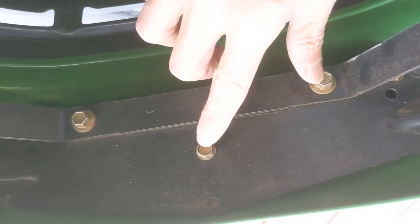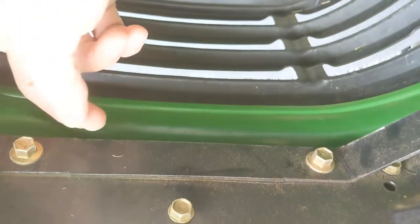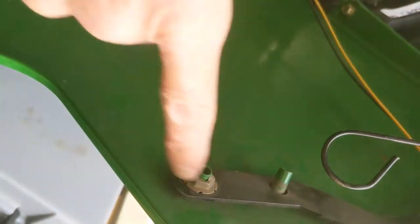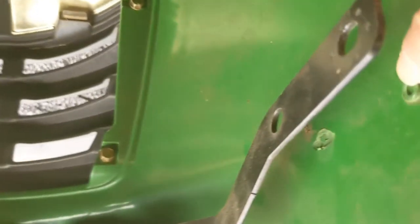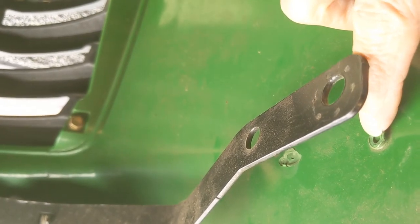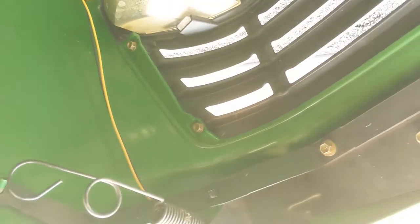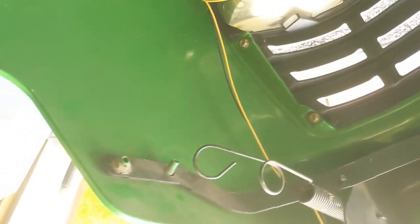The plan is: I don't have to take these two bolts out, but I have to back out that bolt and the bolt underneath here, and the bolt underneath the other side — they're ten millimeter — and get this frame off to give me room to drill. I'm going to clean off anything that's left here with a rotary tool, and most importantly drill a pilot hole in the middle so I know where the holes need to be. When you drill the three-eighth inch hole, the location is critical — if it's not in the right spot, it's not going to line up.